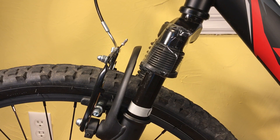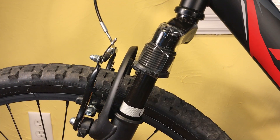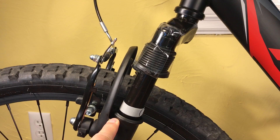That may as well be a fixed suspension because it's not going to do anything on a mountain bike trail or even any significant bumps. That is so little. By comparison, my Trek Dual Sport, which isn't even a mountain bike — it is a hybrid — has 63 millimeters of fork travel, and that's the lowest I've really seen on anything with front suspension of any quality. A true mountain bike will have a minimum of 75 millimeters on the lowest end. Most of the good ones have 100 or more millimeters of travel. So again, 75 millimeters for a base mountain bike — this has 12.7 millimeters.